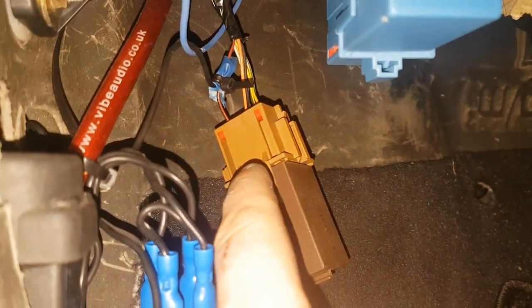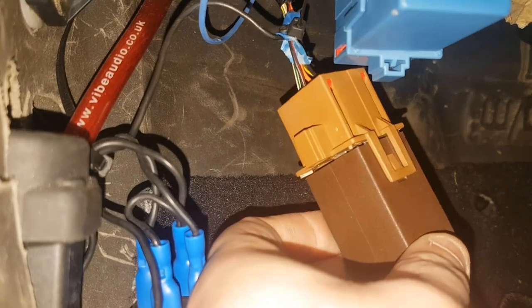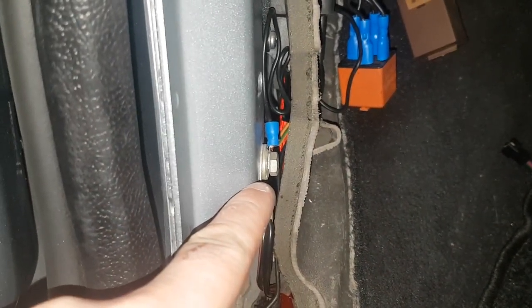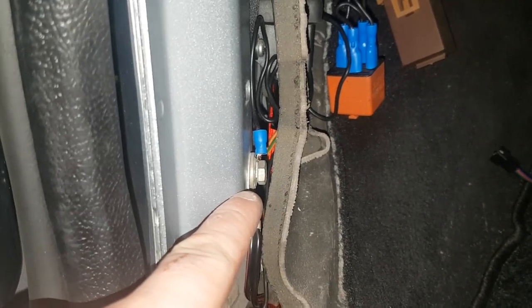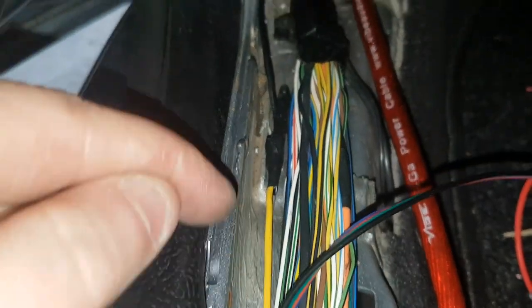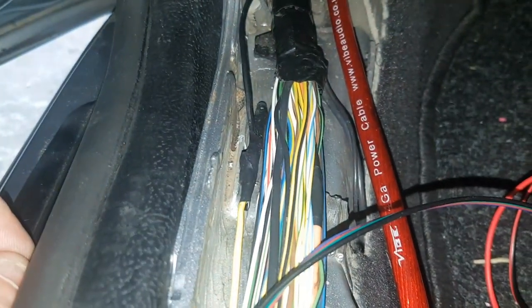You need pin 87 on your new relay to go to the black and red wire on the back of the brown relay. Pins 85 and 30 — the grounded bridged ones — go to the 10mm round bolt here for grounding. Then pin 86, your last wire: trace down into this white bundle of wires and dig around to find the solid yellow wire. Tap into that and that's all you need to do.